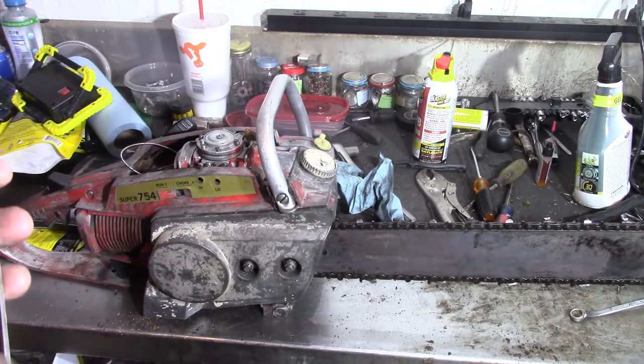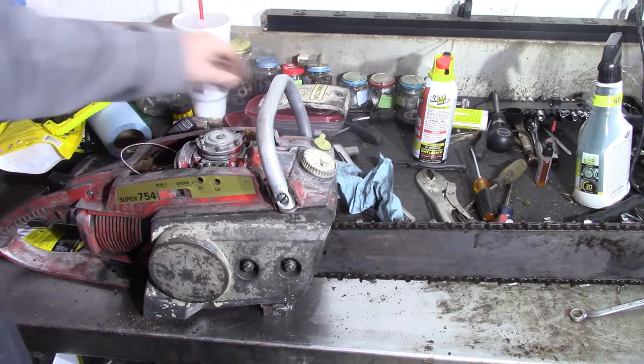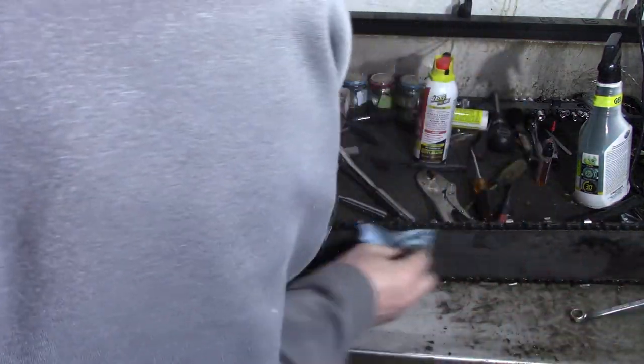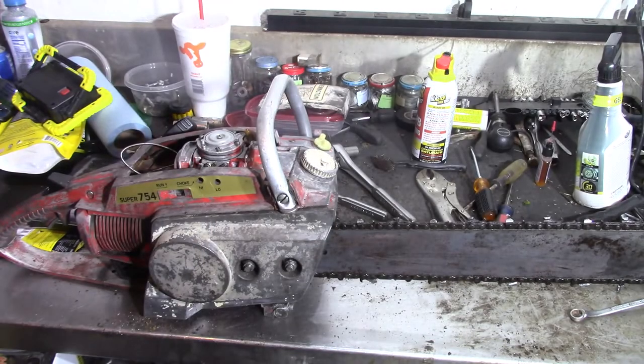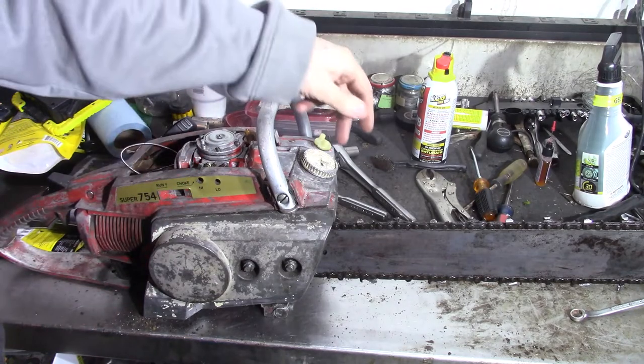I still can't believe that sticker is still on there. Tomorrow — it's too late at night right now to do anything. I just haven't had a chance to get it cleaned up. I soaked the chain down, cleaned the track out on the bar, got the chain back on, and gave it a good PB Blaster bath. Once we get it fired up, I'm hoping — because I didn't think to try it when we had it out there in that short video — I want to make sure the oiler worked. It's got oil in it and a little bit of fuel in it.